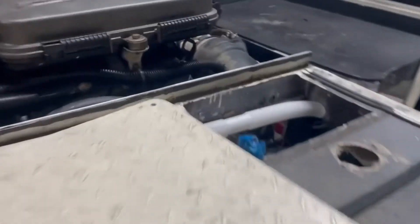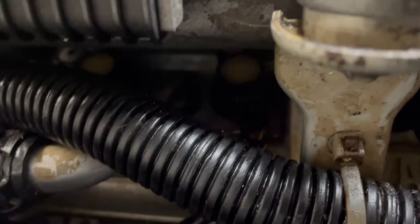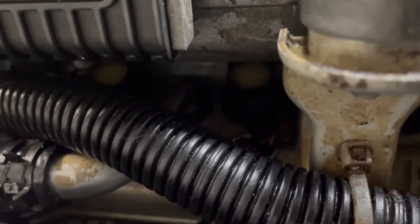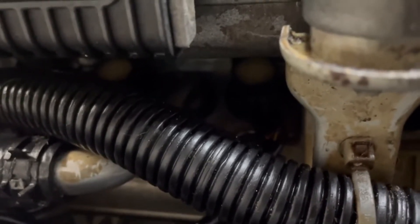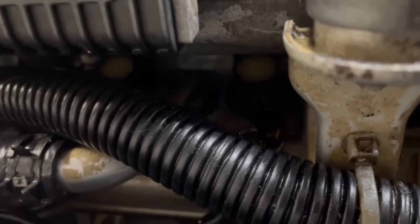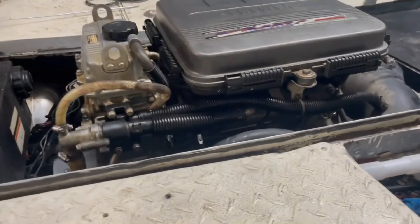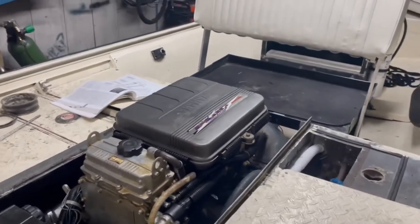There's also a cooling pipe right here that goes into the valve cover with an O-ring on it that can go bad. I talked with a mechanic who said when he does these engines he puts two O-rings on that fitting, so I pulled it out and replaced two O-rings on it. But I was still thinking, maybe there's something else I'm overlooking.